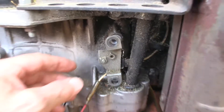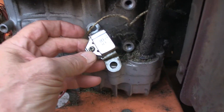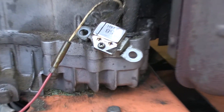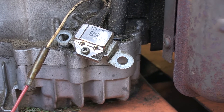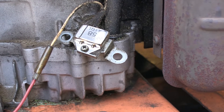I'm going to turn this around — that square right there is the igniter. So if you have an old Scag walk-behind with a Kawasaki engine and you're not getting any spark, this is the most likely culprit.